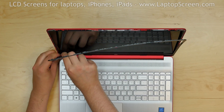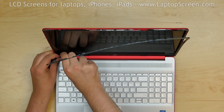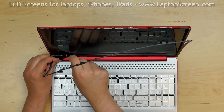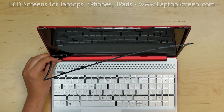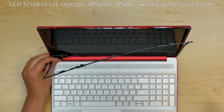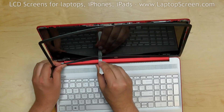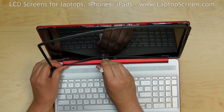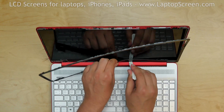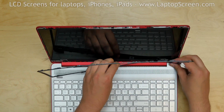The bottom edge is glued in, which is done to prevent any cleaning liquids from getting into the laptop because people continue to spray directly on the screen instead of the cleaning cloth. Use an exacto knife to cut any glue strands, and using a moderate effort, unglue the bottom edge from the display. The bottom edge is held in place with a hinge cover which is not easily removable. Carefully pull out the bottom edge, freeing it from the hinge cover, and set the plastic frame aside.